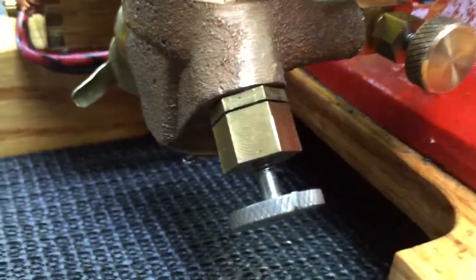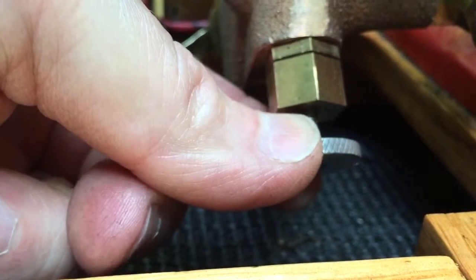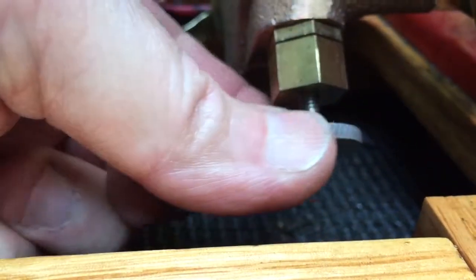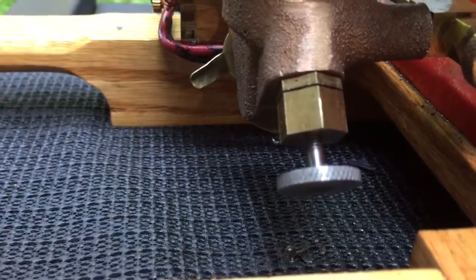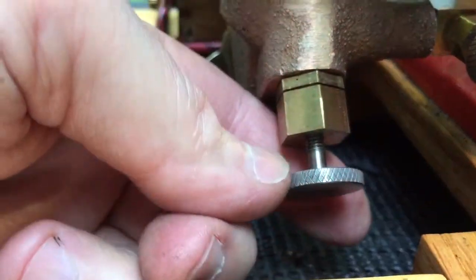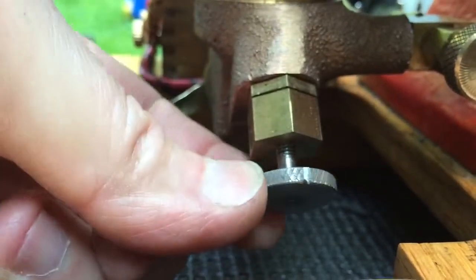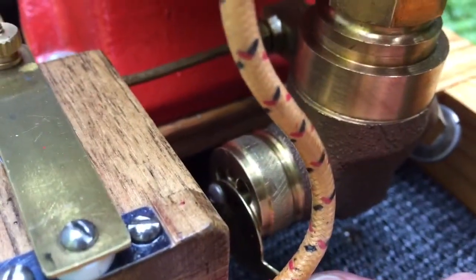On the fuel mixture, this setting is a bit sensitive. I put a mark on it — when it's turned back to the 3 o'clock position the fuel is off; don't force that, just turn it lightly. If you turn this out three quarters of a turn, it's fully open and the needle is completely away from the seat — it's going to be running rich. I've been running this about a quarter turn out, maybe slightly more, with a little bit of choke on.